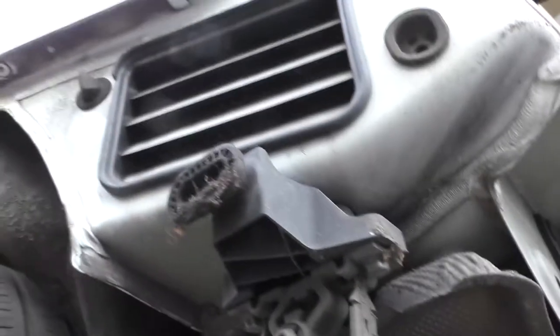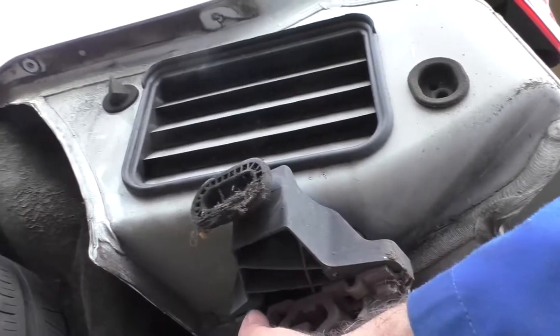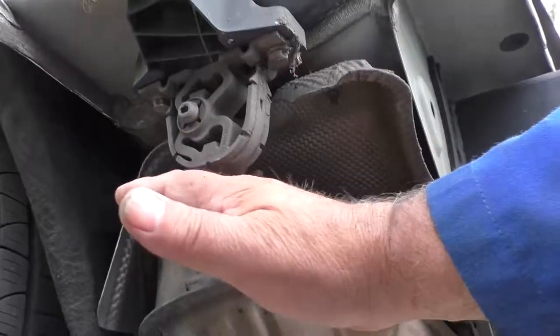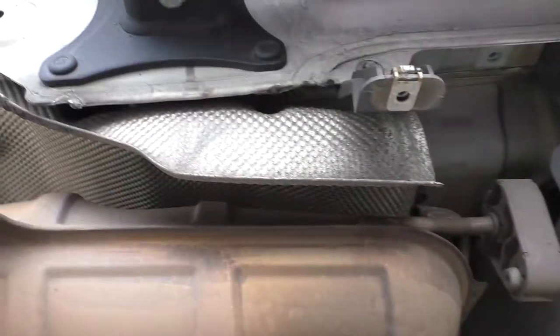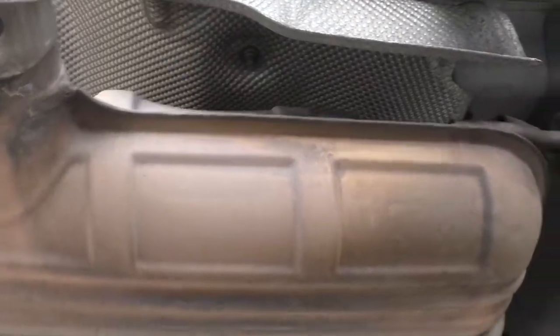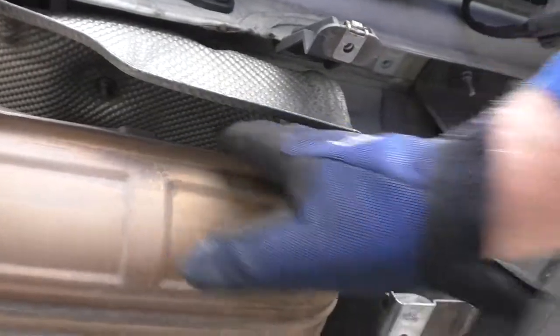And then there are four other bolts, two each, on the outboard corners of the vehicle. So with these hanger bolts removed, as I said before, we need a downward movement of the muffler to get some clearance. With the hangers removed, we can actually get quite a bit of movement just flexing the mufflers. Plenty of room to get to the heat shield bolts now.